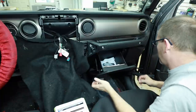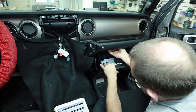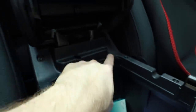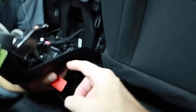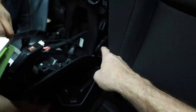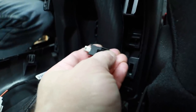Next is removing the glove box. Pull the glove box down. On the driver's side there is a retaining clip that pulls up at an angle. On the top there is a stopper — push that in and the whole thing slides out. We have to get to the factory USB adapter back here; that's what the 6-foot adapter was for. Start by removing these two T20 torx screws here and here to allow the back panel to pop off. We recommend having some form of bin to put all your screws in so you don't lose them. Go around to the back side of the panel — it's a tight panel with metal clips holding it. The cable we're trying to get to is located in the corner next to the passenger seat. Unclip and remove it — it has a little push-down, so push hard and slide it directly out.